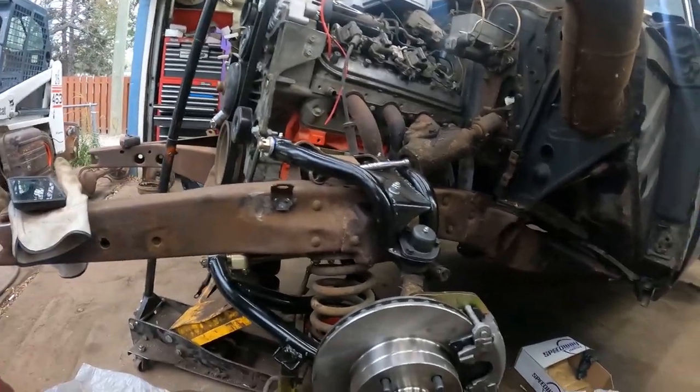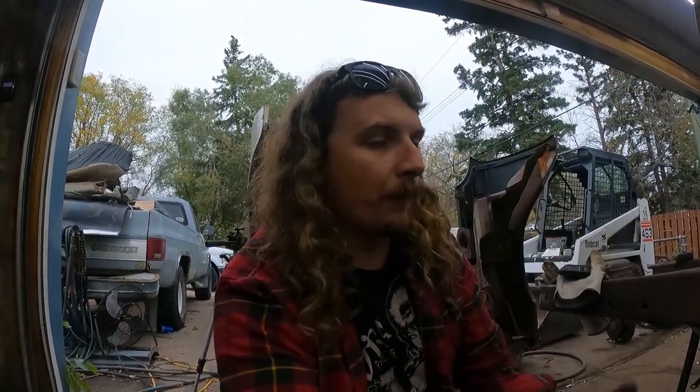I don't know, maybe we'll do the other side real quick. Danny's cooking supper, so I've got time to jam on it. Hopefully this one goes together fast. The only trick is to pack the bearings. I'm sure I've done a bunch of videos. If you don't know, put grease on the palm of your hand and scoop it in there. Google a picture, it's pretty simple. These already have the races in them and everything. You put it together, knock a seal on the back, and slide it together.